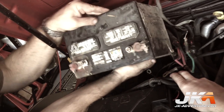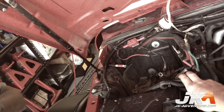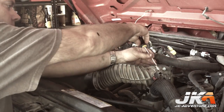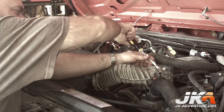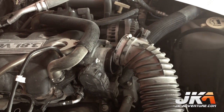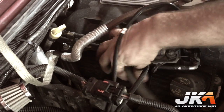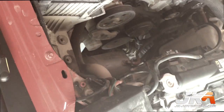We have lots of things to disconnect. First, disconnect and remove the battery — this can be easy or difficult depending on how many wires you have connected to run aftermarket accessories. After removing the gas cap to release fuel system pressure, unplug the IAT sensor. Loosen the clamps securing the air tube to the throttle body and air box, then disconnect the air tube. Disconnect the PCV vent tube running between the valve cover and the air box and set it aside. Remove the air box top and bottom by pulling straight up.